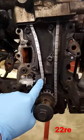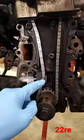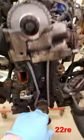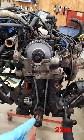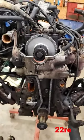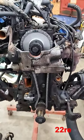Again, make sure your slack's on this side, that way when you put your tensioner on it'll pull the slack out — otherwise you'll be a tooth or two off. Now to verify you've put this in time right, you want to rotate the engine a few times until it all comes back around back up top, and make sure all your marks are still lining up the way they should be. If that happens, you should be good.